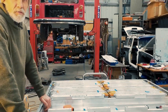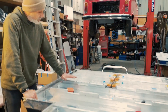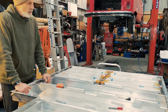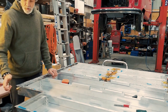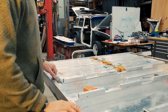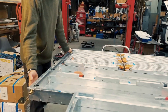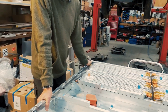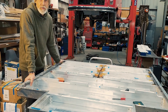This is our main battery pack — it's going inside the car. We've just finished up doing the floor spacers: these blocks here stop the floor pushing down onto the cells because it's pretty tight in there. We've also finished off all the inlets and outlets for our cooling system — things in and out each side here, hooking up a set of series and parallel cooling lines to cool the two packs, one front one and one in the engine bay. Our mounting points are now drilled and ready. We've had one test run — put it in the vehicle, fits nice — and we're just prepping up for the final install of the box on the floor inside the van.